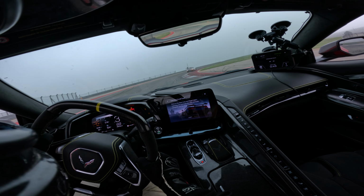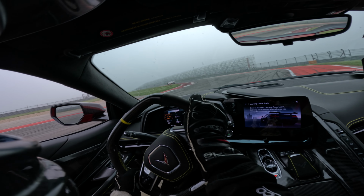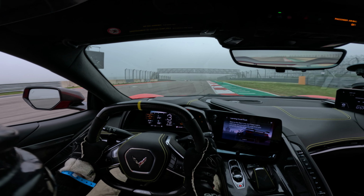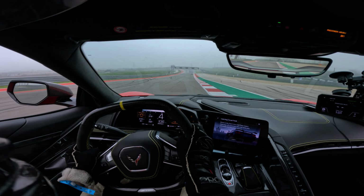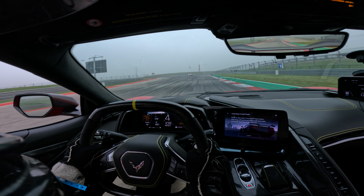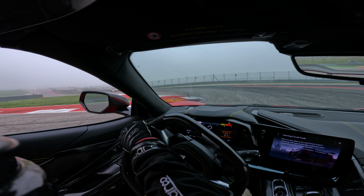Sometimes you have to pull off and lower your tire pressure because too much heat builds up, and as heat builds up in a tire, the pressure keeps expanding, right? You could end up having a 36 or a 40 PSI track tire where it's recommended to be at 32. Pull off, lower the pressure down, therefore you always maintain peak performance. And I think that's basically it.